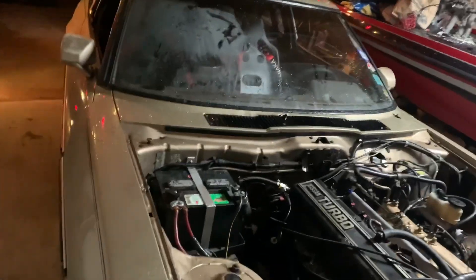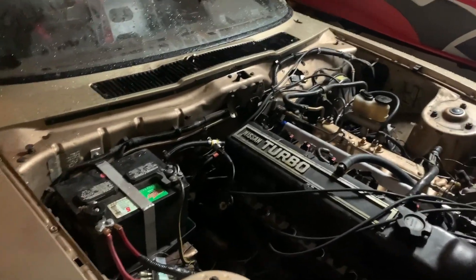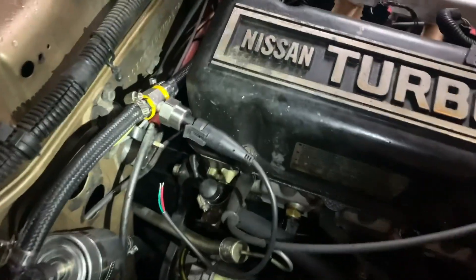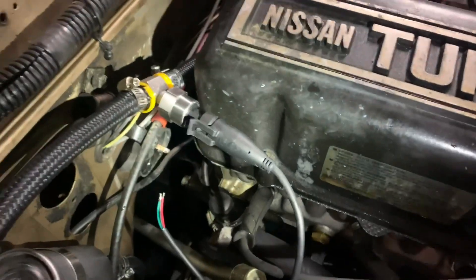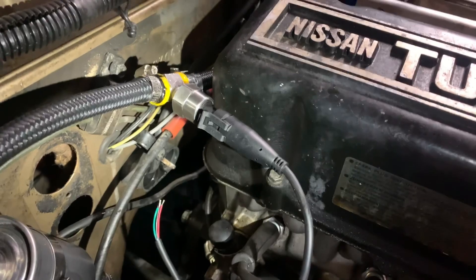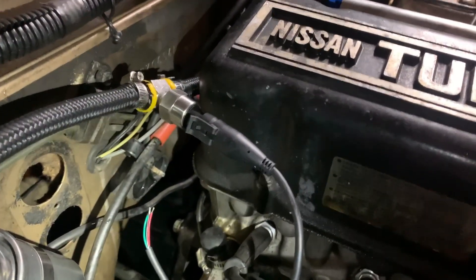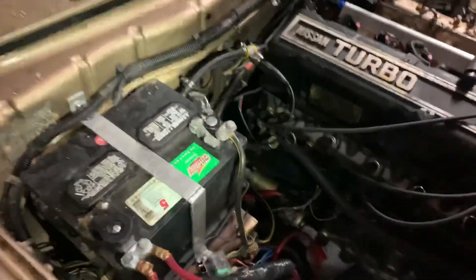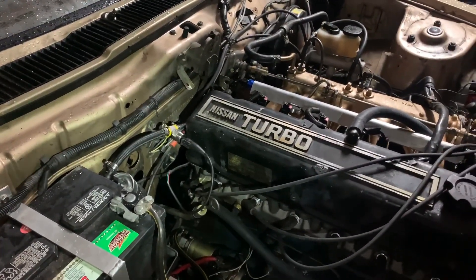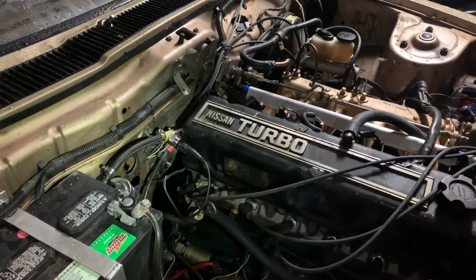All right, it's the next day — just me tonight, still at my house. We had some leaking coming from the fuel pressure sensor. I trimmed up the hoses, redid the clamps, and put some thread sealer on the sensor. Hoping that problem is resolved. As long as that's good, I'm going to go ahead and get the pressure sensor wired up and get the MegaSquirt reading it properly, and then we'll know what our pressure is doing.